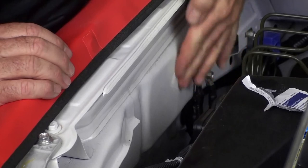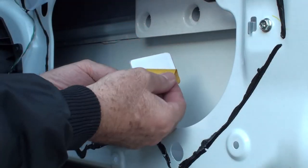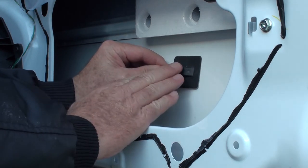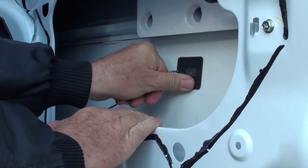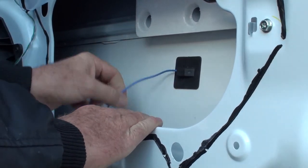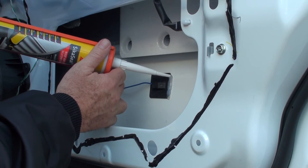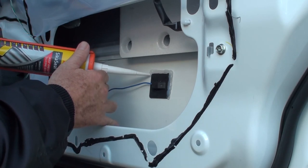To attach the couplers to the body of the vehicle, having selected the coupler sites, thoroughly clean the area with the mediswab supplied and allow it to dry. If the site is very dirty or under-sealed, use white spirits or a similar product and a rag to clean the area first, then always finish with the mediswab. Peel off the paper cover from the rear of the coupler, being careful not to touch the adhesive face, and firmly press the coupler onto the prepared site. Couplers must be attached to a well-painted surface — do not remove the paint, as this can cause the coupler to short and shut the system down. After installation, apply silicone around the edge of the coupler to seal it to the painted surface, as any infiltration of salt air or moisture may cause the coupler to short and the system to shut down.